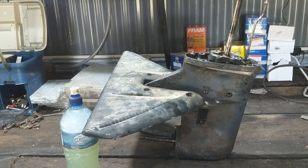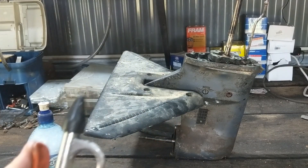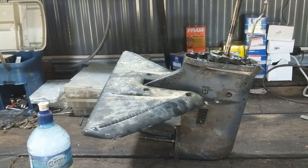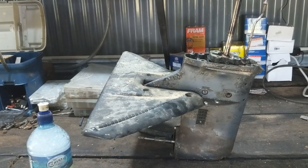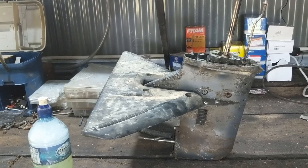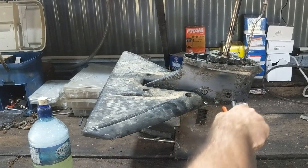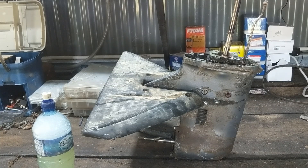The process is this: we have our bottle of soapy water and our compressor with the gun tip. We're only going to go to about 10 or 15 PSI — it's really low pressure. Keeping the drain plug in, we're going to pressurize this, first listen for a hissing escape of air, and then put some soapy water around these seals and see if any of them bubble up. Sometimes they don't appear to be leaking but actually are, so I like to hold pressure for a good 10 or 15 seconds and allow it to bubble up if it's going to.